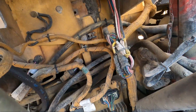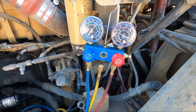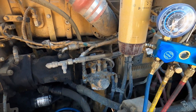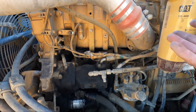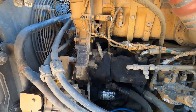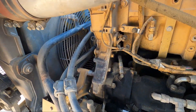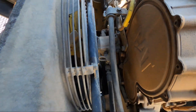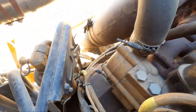I've traced all the lines back already. This pressure line goes under the cab to the condenser where it gets cooled off, then it goes to the dryer, then to the orifice. From the orifice it turns from a liquid to a gas and goes to the evaporator core where the air blows across it and goes cooler in the cab. Here's the suction line right here - looks really good all the way along.